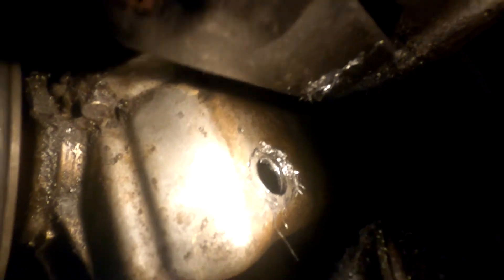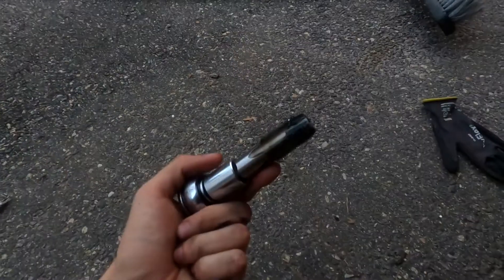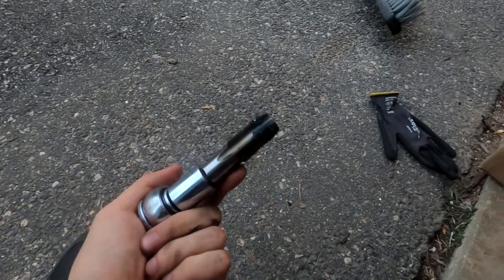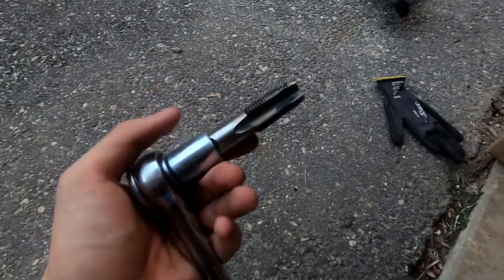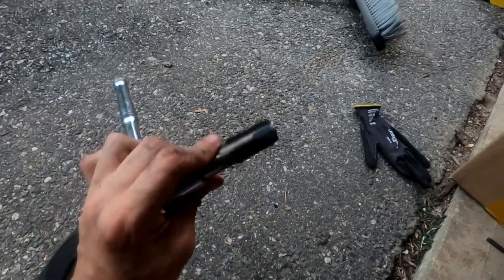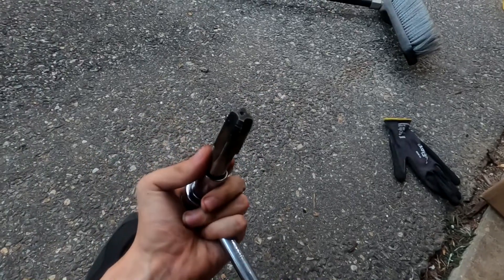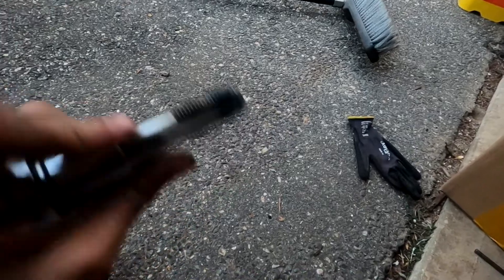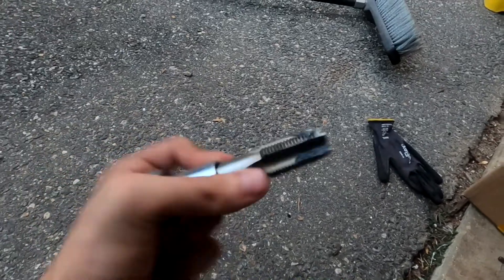Final stretch — this is going to be really light pressure, just barely breaking through. Even though we have that stop on there, we don't really want to have to rely on it, so just be careful. We are in — that is a really nice hole in the oil pan, and it went pretty smoothly. Now I'm going to use some Q-tips with grease to get out all the chips from the inside, or as many as I can. Then I'm going to go ahead and tap it with the corresponding tap that you used for the drill and for your fitting. Use a lot of grease during this process to catch all of those chips, because once again you don't want them going into the pan.